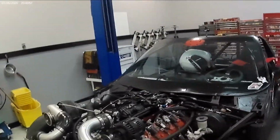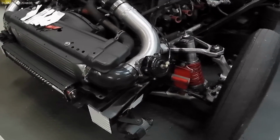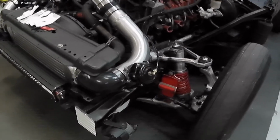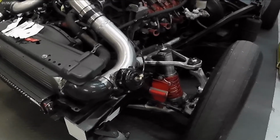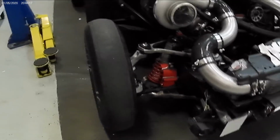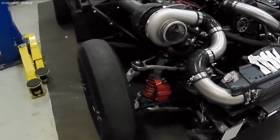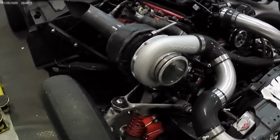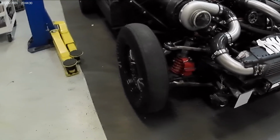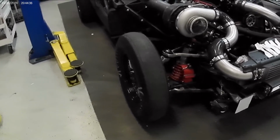I don't think what's helping me much is that it still has the 400 pound-inch springs in the front that I had for autocross. I also made some homemade limiter straps out of an old racing harness, being unsure what this thing was going to do. If it hooked, was it going to yank the wheels? Because this is not an optimal setup, and it'll actually cause a gap between the collar and the shock mount itself, so I wanted to limit its travel. To be honest with you, I don't know if it hit them at all last night. I haven't seen any videos from outside the car.